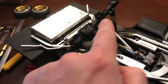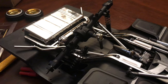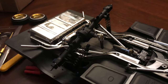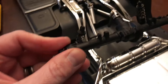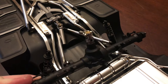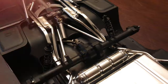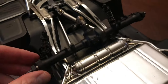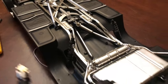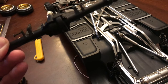Let the axle down and take out the other side. Then we'll pop off these trailing arm mounts, and the rear axle assembly is free. The other shock assembly has been removed, and we're just going to pop off these pinion angle trailing arms. The axle is free after that. The rear axle has been removed — we can slide aside the rest of the chassis and focus our efforts on the rear end.